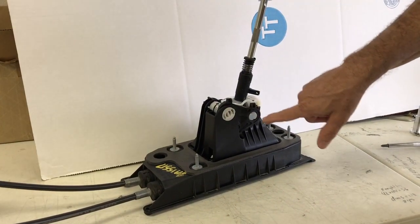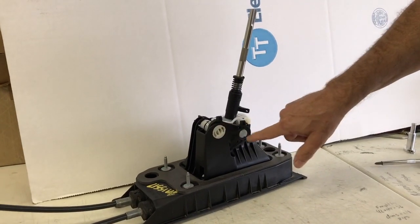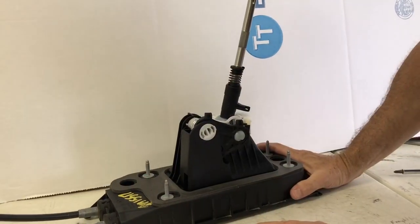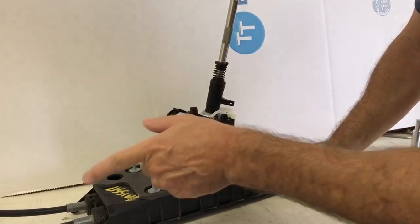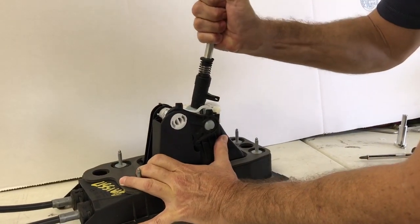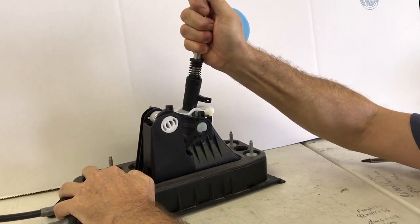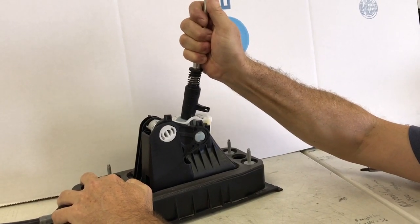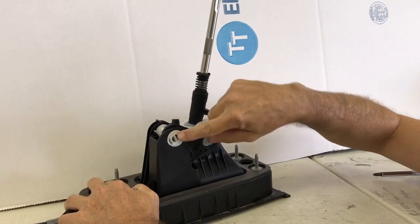There's actually a good deal of slop here and here, and this is for the side-to-side direction. Right now I have an old throw-down five-speed transmission hooked up to these cables and it's locked into the home position, so nothing up there is moving. In the side-to-side movement, you can see that when I move the stick side to side there's a whole lot of slop in the system, and it's not a problem with the parts — it's just the fits of the parts.